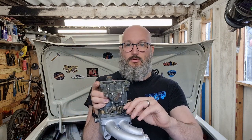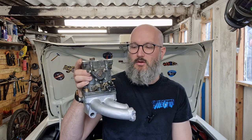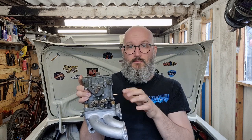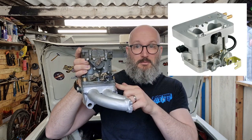Carb versus EFI: in its basic form this carburetor — a 2836 DCD — you open the throttle, air goes through the venturi, you've got emulsion tubes and jets, and depending on the vacuum you pull and the jet settings, fuel is drawn through to the four cylinders. You can get a throttle body to fit this manifold, but I've opted for ITBs off a CBR 600 motorbike, which work in a similar way.